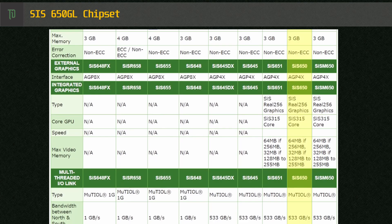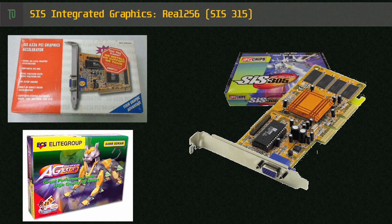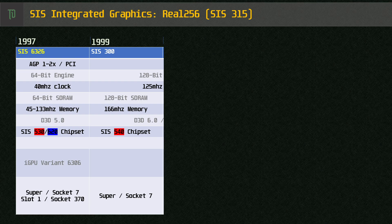As a result we're dealing with the SIS Real 256 graphics based on the SIS 315 core. SIS released only a small amount of discrete 2D/3D chipsets during the late 90s to early 2000s, most of which were at the very bottom end of the market. Starting out in 1997, the 6326 was a multimedia-focused card with some versions having hardware to decode MPEG-2 or DVD playback. It had support for Direct3D 5 with limited OpenGL support and often had very low frame rates. During 1999, SIS released a second generation 2D/3D engine called the 300, featuring a new 128-bit engine, Direct3D 6.0 and OpenGL 1.1. It was a significant jump in performance over the 6326, and the iGPU was found on the Socket 7 platform.